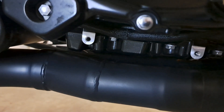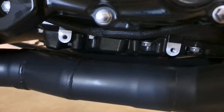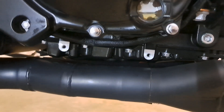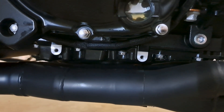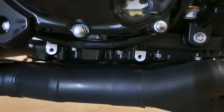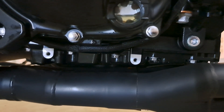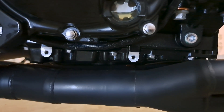A little bit more of a close-up view. You can see we've got just about a quarter of an inch of clearance at the very back of the oil pan. Everything else is just kind of cradling that oil pan. And right here is why it's so important that you remember to remove the bracket — that's a step you're going to have to take because if you don't remove that bracket, which just holds the wiring for the O2 sensor, it will absolutely be in the way and you may end up gacking your exhaust. Don't forget that step.